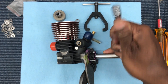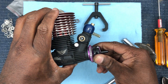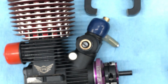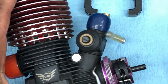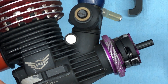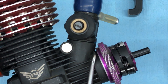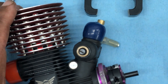Tighten that up a little bit, grab your channel locks, grab your flywheel real fast, and tighten it down. Now what might happen is you run into a problem — see that? That's stiff, that's hard. Let me zoom in. Right there — that's a pinch point. That flywheel is rubbing up against right there where the carb is at. You see that? It's rubbing right there.